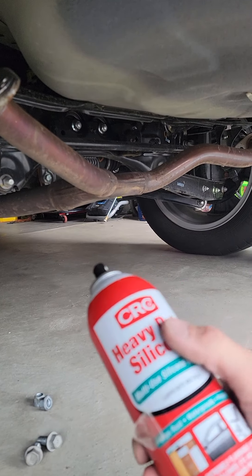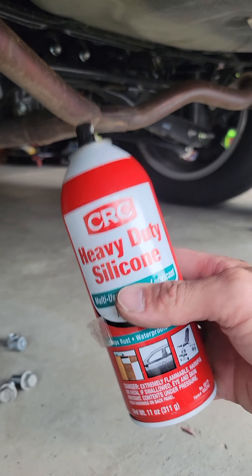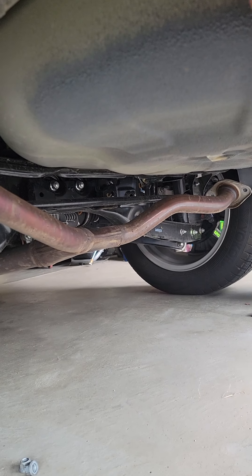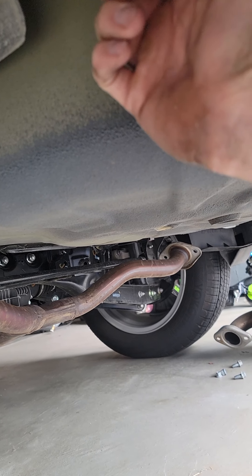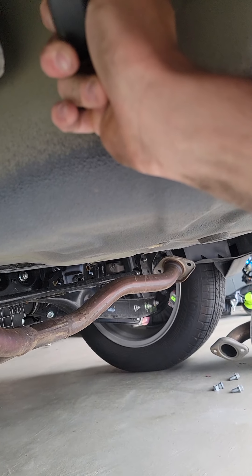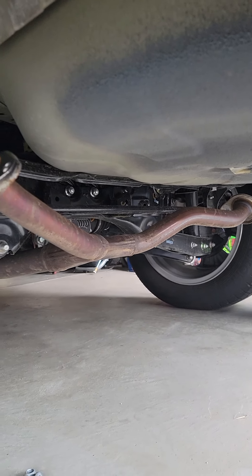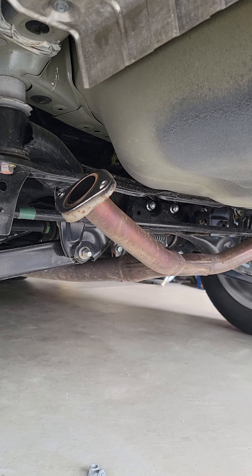I always tell you, you're going to want some heavy duty silicone in the garage. The reason you use this under your car is because eventually it dries — it's not greasy, not sticky, not gooey. The car has about 4,000 miles on it, so the hangers were kind of stiff. While the muffler is up there, go ahead and spray the hanger piece with silicone, and then literally for the next day or two they slide right off. Use silicone versus a petroleum distillate lube like WD-40, which can eat rubber — we don't want these things loose indefinitely, we just need them loose for a minute.